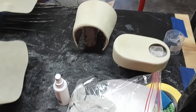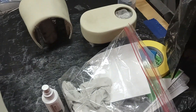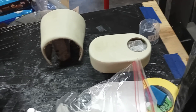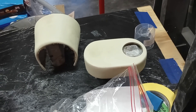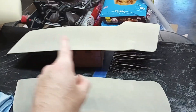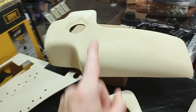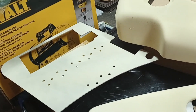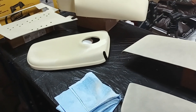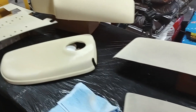Here's a look at our first coat of primer going on. The prep kit comes with gloves, wax degreaser, tape, body putty, and everything you need. Always remember when doing primer: wear gloves, wear long clothes, don't get it on your skin, and wear a NIOSH approved respirator — because this stuff is the good stuff. Light cover still shows a little black through, which is okay. You can do two or three coats, and you only need to let it dry 20 minutes between coats. Then let it sit overnight to fully cure before starting your base color.